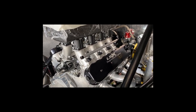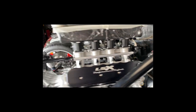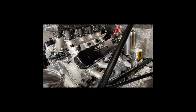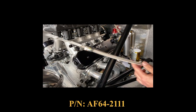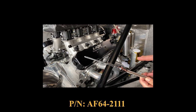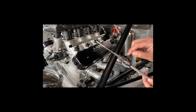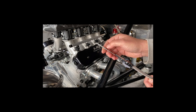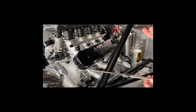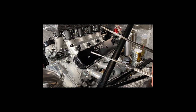Some things are always a little bit annoying when you order engines off other people — for example, this dipstick: it's ugly and a pain to use, so I've bought an Aeroflow aftermarket item, about a hundred bucks. It's basically some braided line with a mount and a billet top — quite nice. But any time you purchase these, be very careful: just because it says it's for an LS3 doesn't mean it fits. You need to make sure the distance between where it seats in the engine block and the bottom of the dipstick is accurate. I've heard of a lot of guys getting an aftermarket dipstick of the wrong length and ending up with the wrong amount of engine oil in their car.